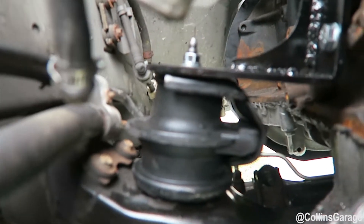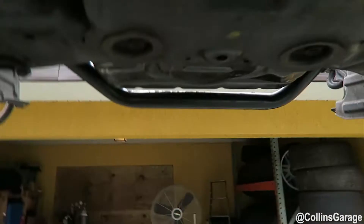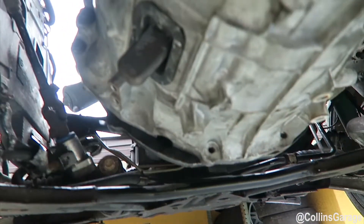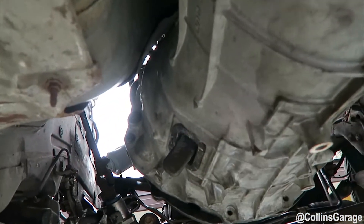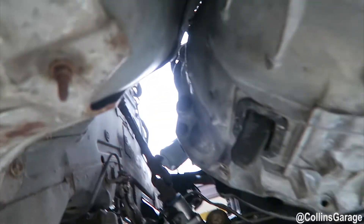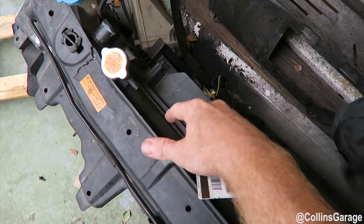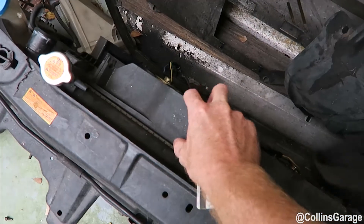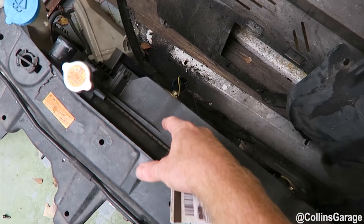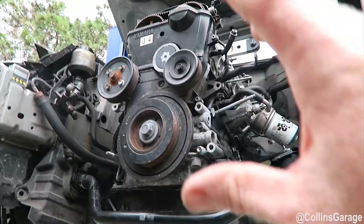We slotted the mounts — I'll give you a better view when we lower the vehicle down. What I'm trying to show you is the fitment under here and why we did a few of the things we did. We kept the same stock CD09 transmission, and the reason we couldn't go farther in this direction is the tunnel has a limiting factor from this casting. So we shoved the engine and trans back far enough that you can get the stock radiator support, condenser, and stock radiator in — but not the stock fan shroud. You have to go with a slim fan set for a pull-type fan system, but you are able to get the whole structure into the car with the 2JZ or 1JZ system on these mounts.